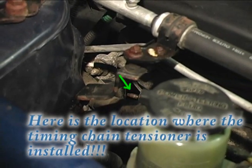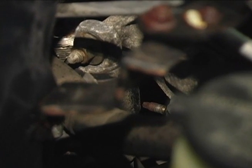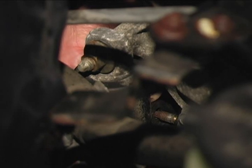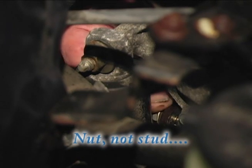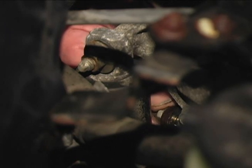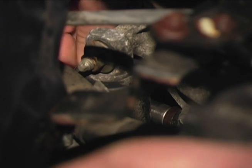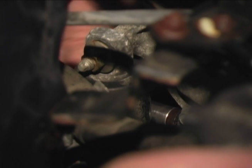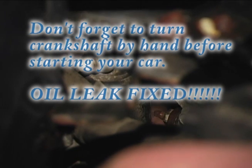The tensioner is on the cylinder head way at the end of the cylinder head on the back — and there it is. You can see this mechanism, and you can probably see the O-ring just below the stud right now. We'll put on the top stud with a flex wrench. I can feel the O-ring is now going in there, so that's good. I'd like to show you a different camera view, but as you might imagine, there's not a whole lot of space here to get a camera.